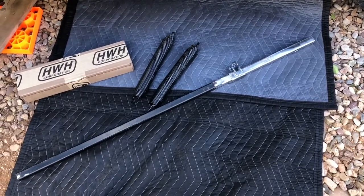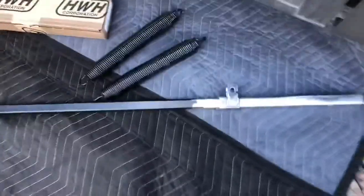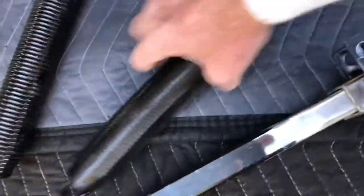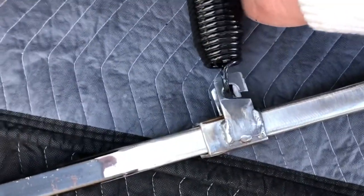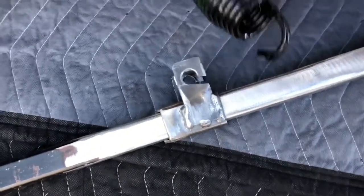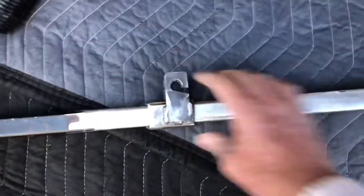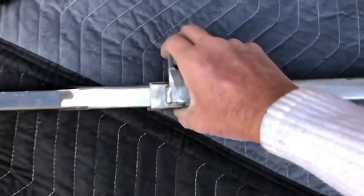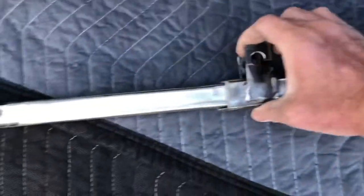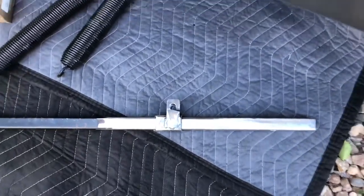We'll see if we can get it to work on the front. The idea is that you hook this little device around the coil spring, so as you come up to the coil spring you can just hook right onto it, and then that'll pull as you pry down the spring out of the foot pad of the hydraulic jack. Depending on what you're prying against, this will slide completely off the tool, or slide to the exact measurement you need for prying.